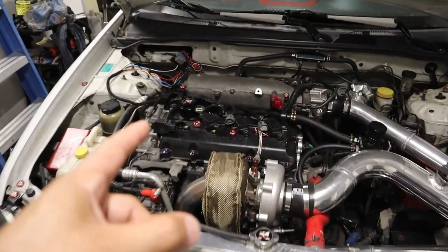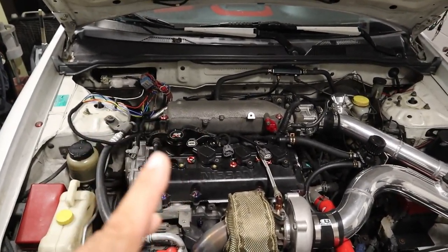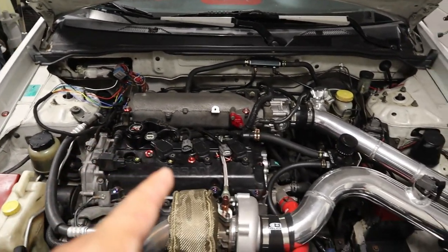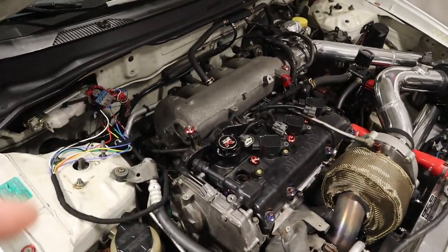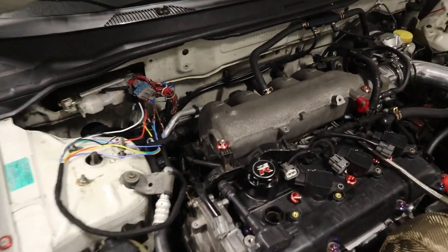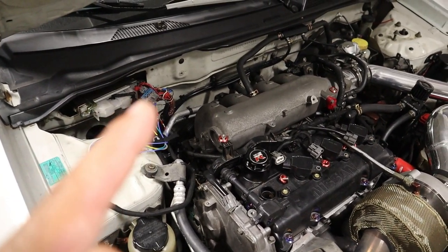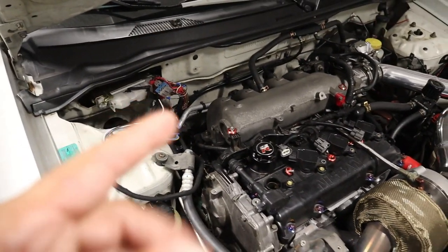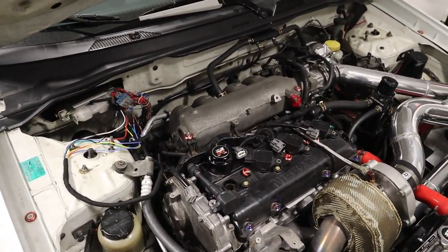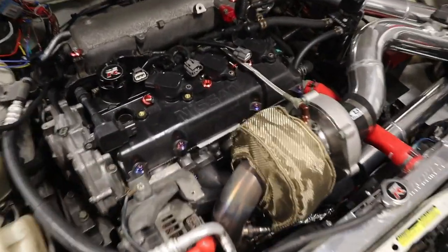Once I was finished I was too eager to turn it on. I did skip one step which was crucial to protect the coil packs themselves. That step is something as simple as adding some diodes to lower the voltage going straight to the coil packs, and I didn't do that. So what happened — I cranked it and it burned the coil packs, but that's okay because they're replaceable.